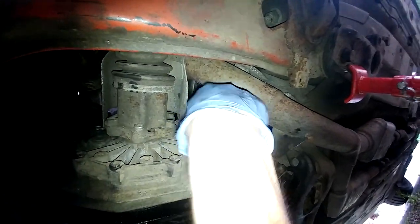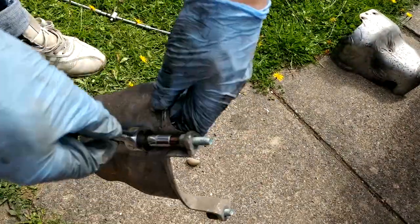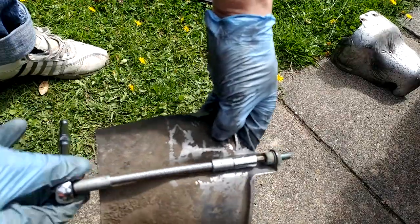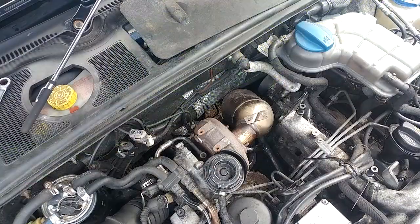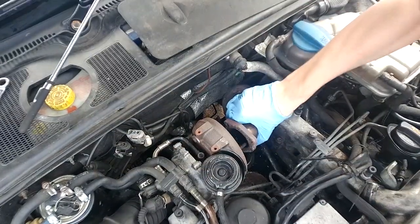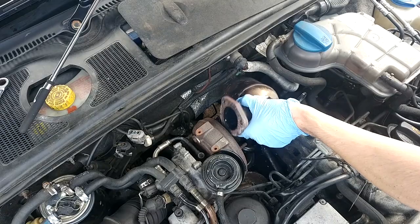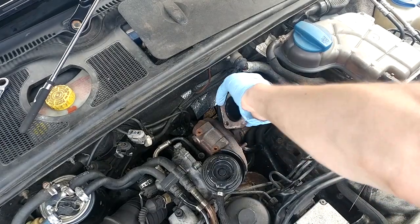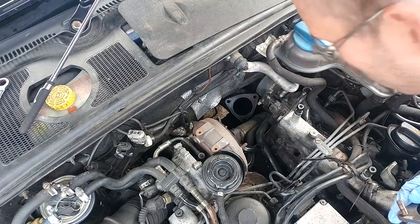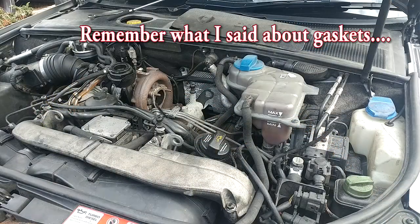Please excuse the oil you're seeing on my engine — my car's got nearly 200,000 miles on it. With the heat shield off, I wanted to show you what kind of poor access you have to the part on top, and this is where the extensions came in handy. You might be able to do it with a wobble bit. So now everything's undone on the cat and we've got the heat shield out. We're going to take the cat off — you might need to pry it off and work it a little bit just to free it up on the bottom connections, then pull it up. Take care to hold the gaskets and not drop them if you're looking to reuse them. Ideally you should replace the gaskets. This is the original cat — let's start the car with absolutely no exhaust and see what it sounds like.